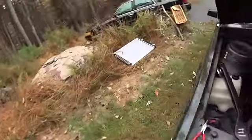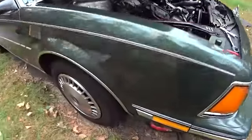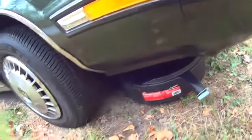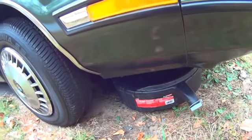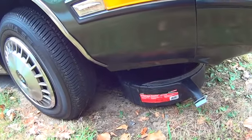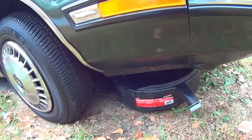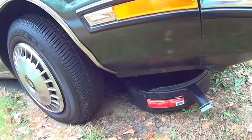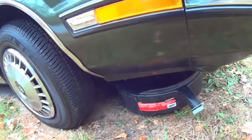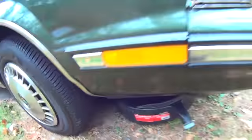I drained the coolant — this is the coolant I just put in a week ago so it's all nice and clean. I flushed the engine and radiator four times, had it run for over an hour with different detergents. So it was nice and clean when I put in the new antifreeze, and then a week later I found the leak on the radiator.